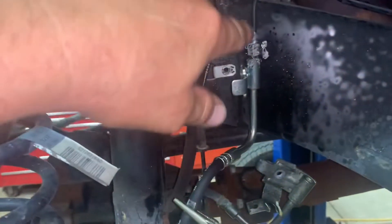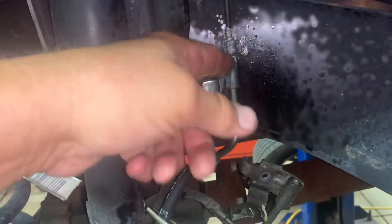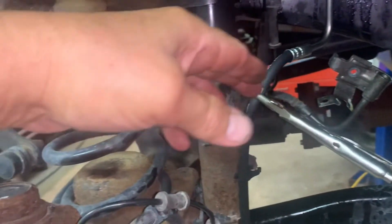You've got your line started under the fitting. I put some anti-seize on it, threaded it in there, snugged it up, and then put a small pair of vice grips on there — just enough to squeeze it and restrict the flow so it doesn't drip out all my brake fluid.